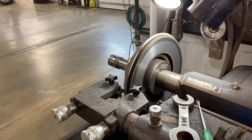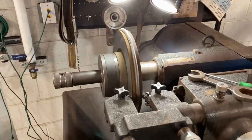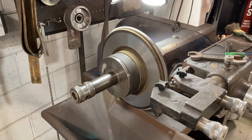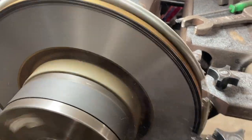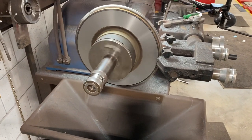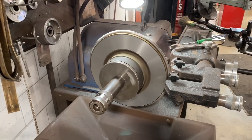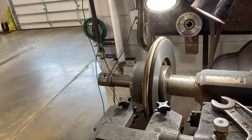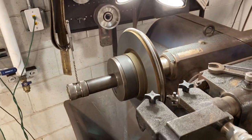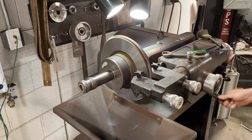Once the tips are set we'll hit the gear and let it start cutting. You can see we get a nice smooth finish on the rotor. This process takes about five to six minutes per rotor to cut. Typically we'll cut it first a little faster and then take a second cut very slowly to get a nice factory finish. The first cut's complete — we're going to wind the head back in one more time and take a real light pass at a much slower pace.